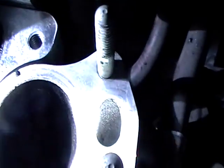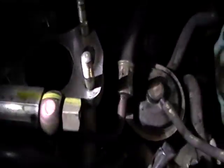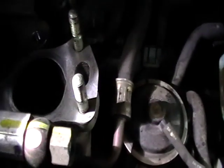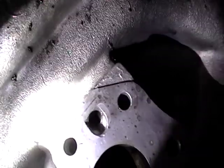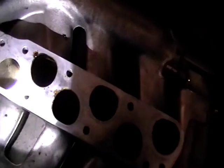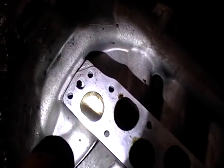I'll show you how we cleaned it up. Nice and clean, perfectly fine. This is the EGR port — nice and clean, perfectly fine. All you need is brake cleaner, an air hose, and of course something like a little brush, or anything that can pry the buildup a little bit out of there. And I'll show you the intake — we also cleaned the intake. As you can see, nice and clean all around. Air, brake cleaner, and a brush or something in that field. So that's how you clean the EGR ports on the Honda Acura V6.